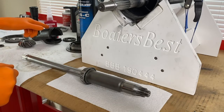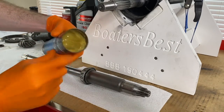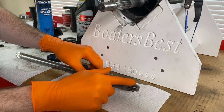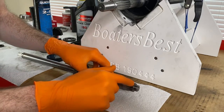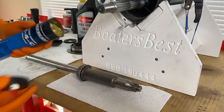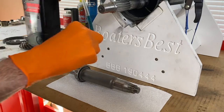Focusing on the drive shaft bearing as well as the lower splines, I've got some 2-4C grease and I'm going to lubricate the lower splines of the drive shaft. Do not get any grease on the actual thread where the pinion nut will screw in. Just apply the grease to the splines, nowhere else, and do not overdo this. We are now going to grab the SAE 90 gear lube - the exact gear lube we put in the lower unit - and lubricate the roller bearings on this drive shaft bearing. Just like the grease, do not overdo it.